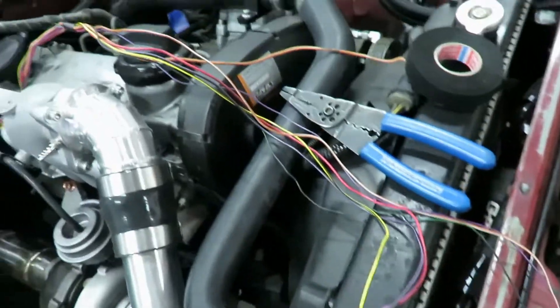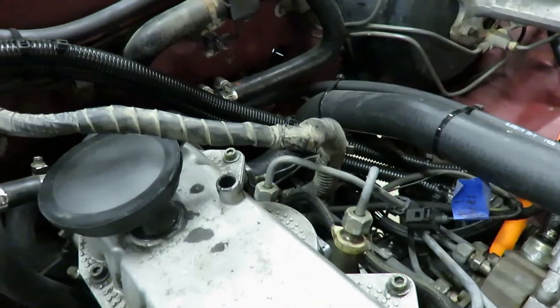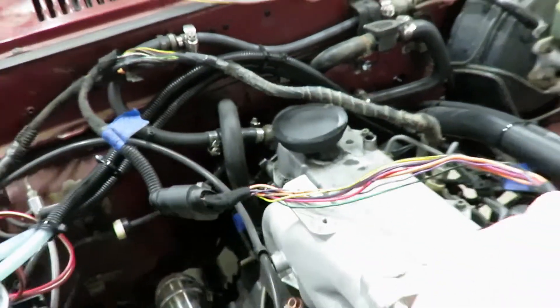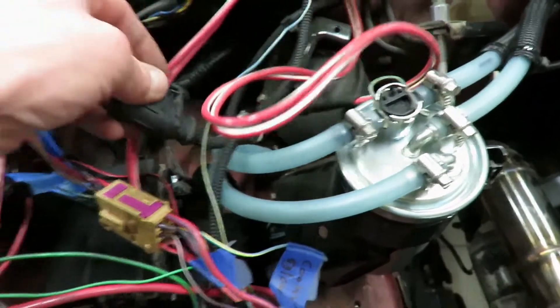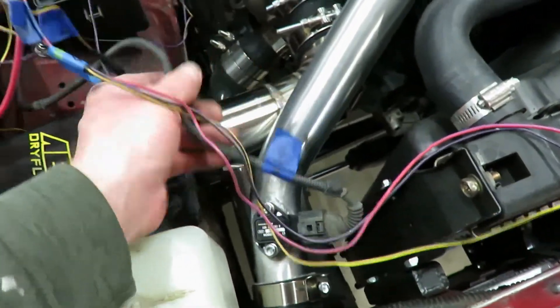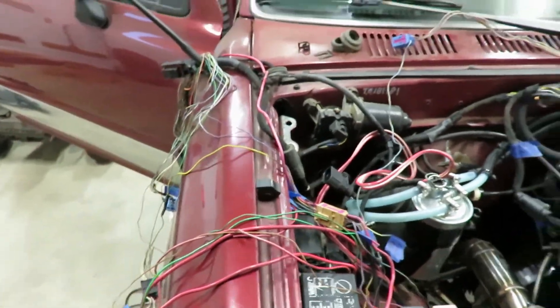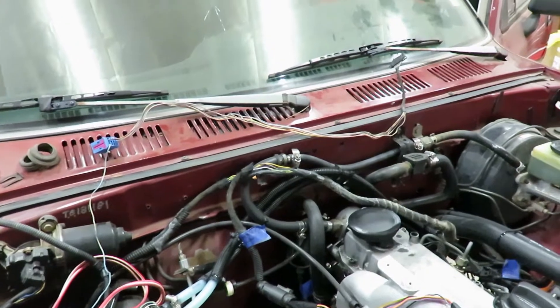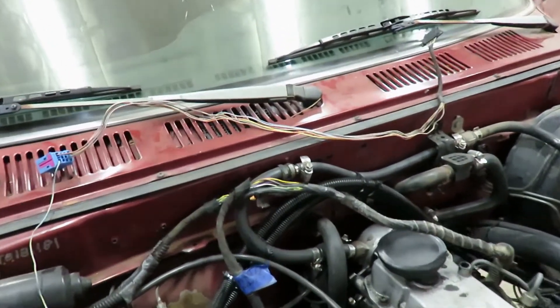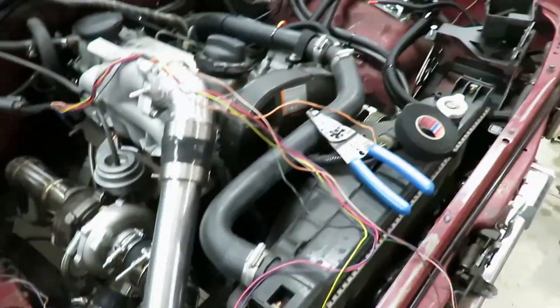All this here is for the injection pump and everything looks pretty good — though everything's a bit too long. The glow plug wires are way too long so I'll shorten those up. The map sensor is right about perfect. I'm going to start tucking some of this wiring and run that throttle pedal through the dash to see if I need to extend those wires at all.